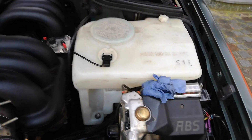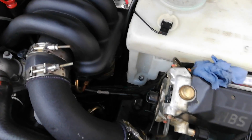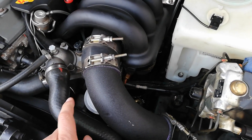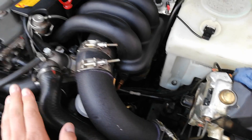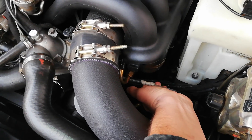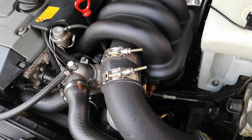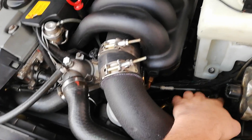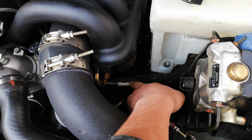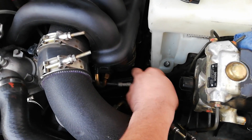I'm also reusing the evaporative regeneration system — the MOT valve for tank ventilation — and that works now. I had to add a one-way check valve here, because boost pressure was cracking the regeneration valve open. The check valve prevents boost from getting inside.